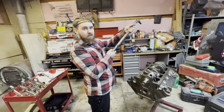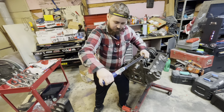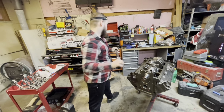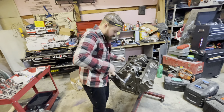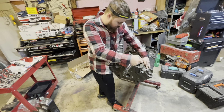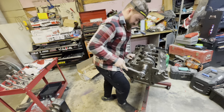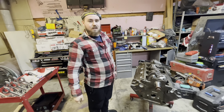And then you rotate this thing to make sure it's moving fully and not stuck. I don't have the correct tool to do this so I've got a crank bolt in there, but it's working. Is that kind of hard, do you think? Not really, no. Check them again and then I'm going to do all eight cylinders and we'll be back.